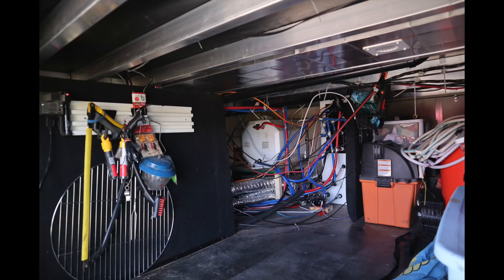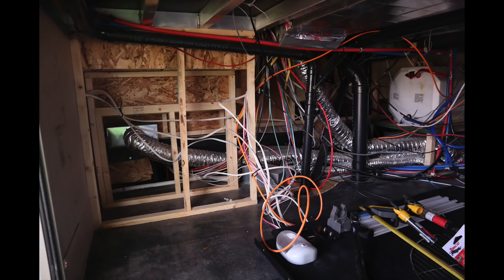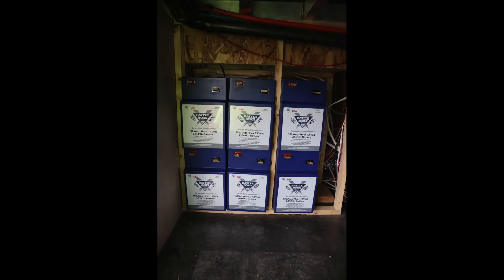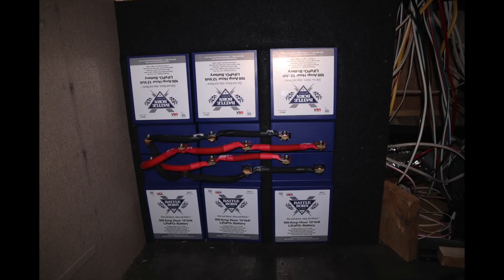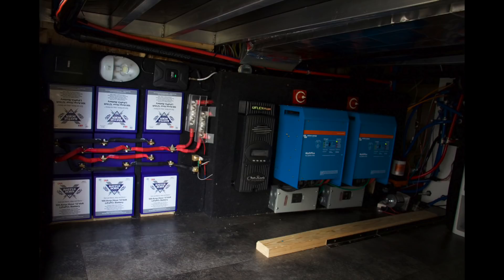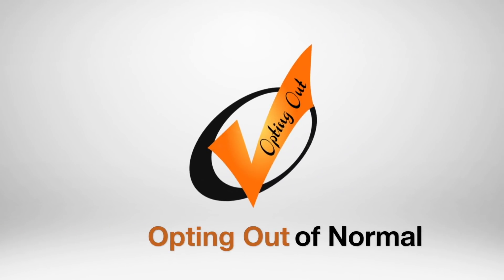That pretty much wraps up our entire system step by step. I'm going to leave you with some of the rough pictures from during the install process — removing the original factory OEM walls to mount the batteries underneath the stairs. Overall I'm pretty impressed with how things turned out; the system has been working great. The only thing I have yet to upgrade is changing out my solar charge controller with two Victron 100-50 charge controllers so I can make better use of the 1400 watts I have on the roof. If you have any other questions, please feel free to leave comments below. Remember to like and subscribe. Live simply, give more, and expect less — until next time.